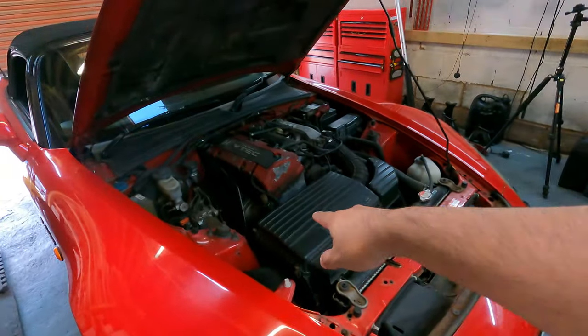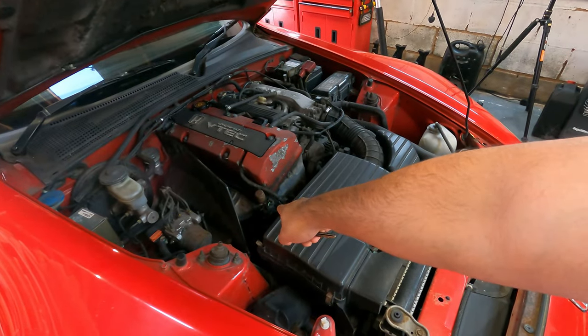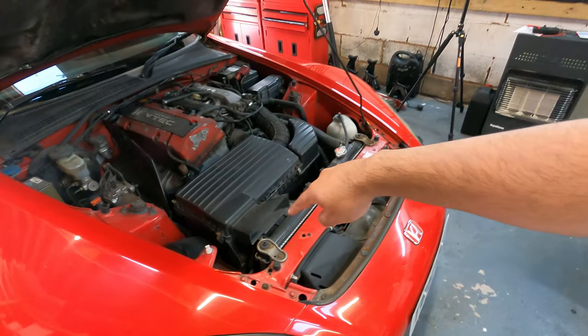I had to open up the garage door because otherwise you can have a pretty bad incident with carbon monoxide. First things first — to get access to the timing chain tensioner, I'm going to remove the air box. As you guys know, I've done that before for the intake mod, which sounded so good. Once that's off, I get good access to everything else.